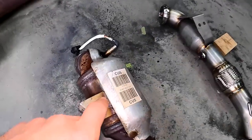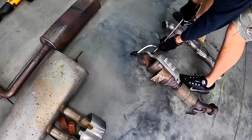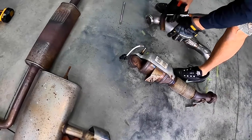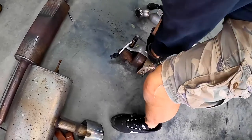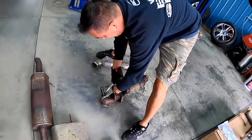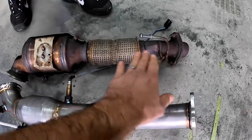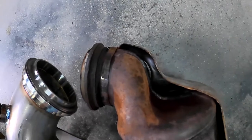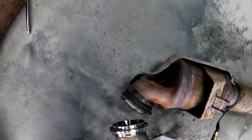I like the label on it, because you're probably going to cuss getting this thing out of here. At first I didn't think the stock piece looked like it was too bad, until you see this massive crimp down right off the turbo going into the cat. That's a horsepower-robbing piece if I've ever seen one.